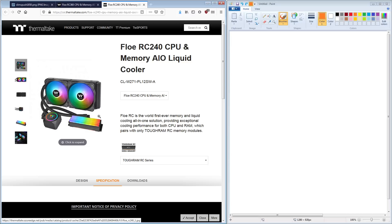Rev-E Micron is also pretty temperature sensitive. My experience hasn't been too bad with it, but apparently it is pretty temperature sensitive. It's not been as much of a nightmare as B-Die. Samsung B-Die - you run a memory stress test for an hour, and at the start of the test it's completely stable, and towards the end of the test it's just puking errors everywhere because the sticks are two degrees too hot. When I say two degrees too hot, I mean the memory stick instead of being at 40 degrees is at 42 degrees, which is actually enough to destabilize a memory overclock.